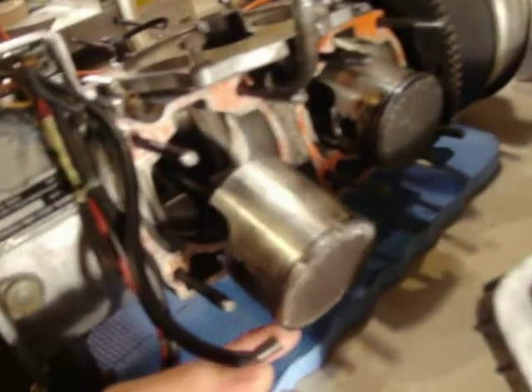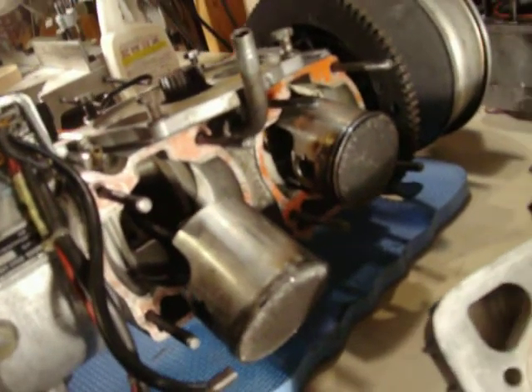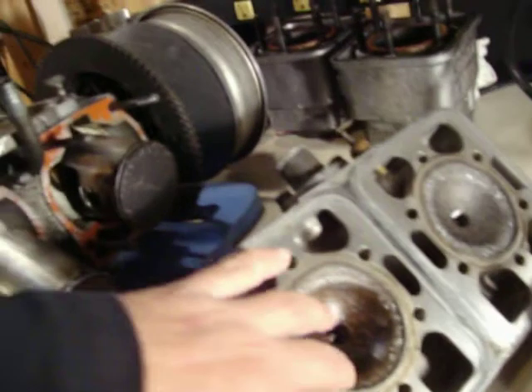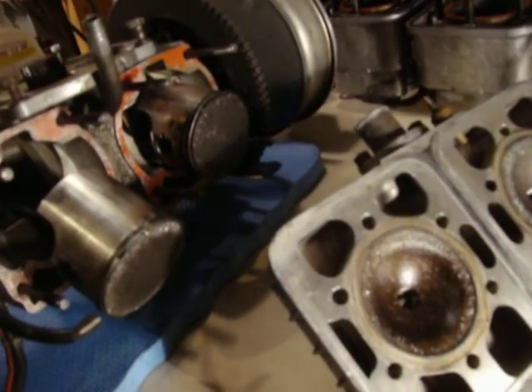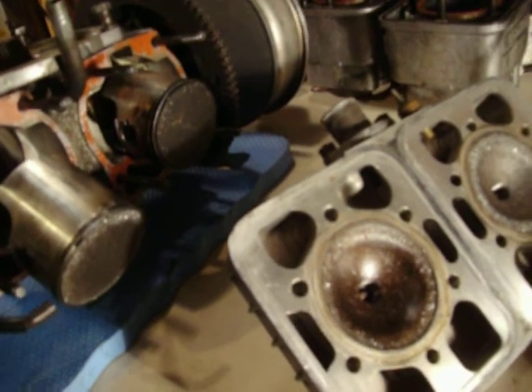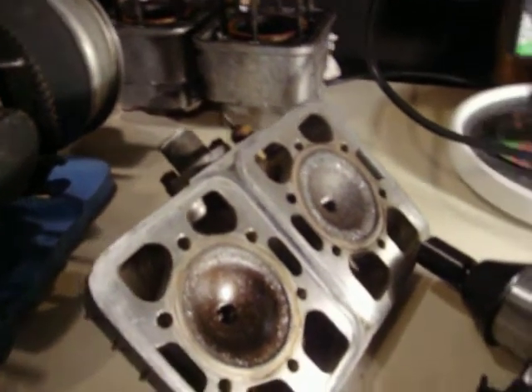It looks like there's been a lot of damage done to this engine. I don't know whether it's salvageable — obviously we have to open the crankcase; that'll tell the story. Two new pistons for sure, plus heads. The entire surface of the head casing will have to be cleaned and smoothed to get rid of all those shards. Someone will tell us whether this is salvageable or we go for broke.